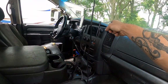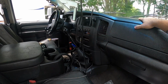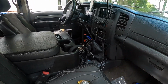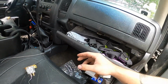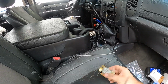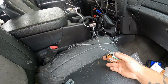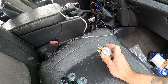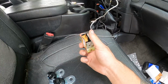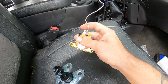But the relay up front is grounded by the ECU, and that's where we're not getting our power. We're not getting any ground from the ECU. How do I know that? Because I grounded it myself and it goes fine. So everything's been tested. So basically what I'd have to do is pull all this out, stick this in the evaporator, and then run, you know, I thought about wiring it into where the ECU comes in to ground it, so that this would actually just ground it and I'd be able to use all the factory wiring. I'm thinking about that. But I don't know if this thing needs a positive and a negative, because I can see that it gets grounded and mounted somewhere, but I'm not sure. I'm definitely new to this.